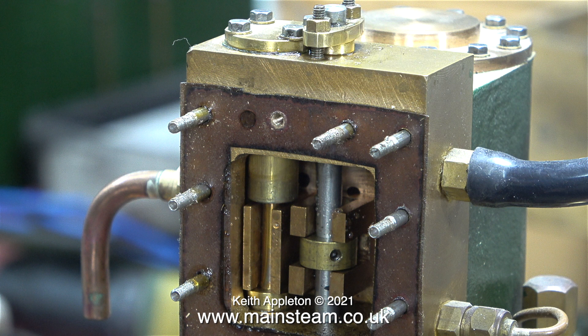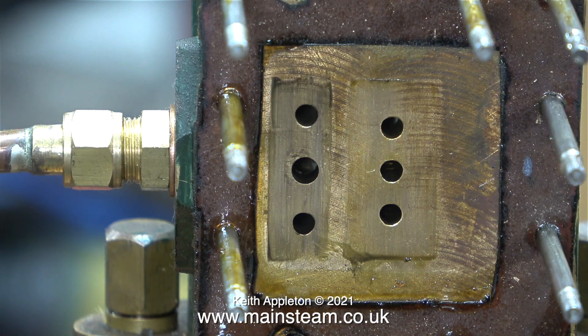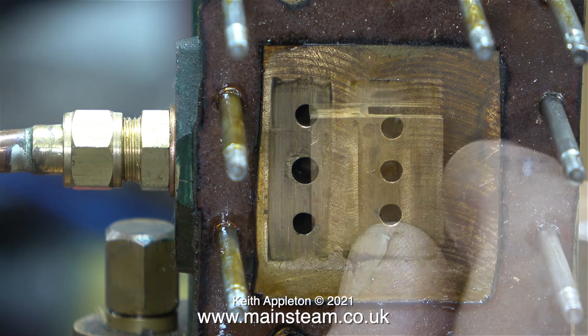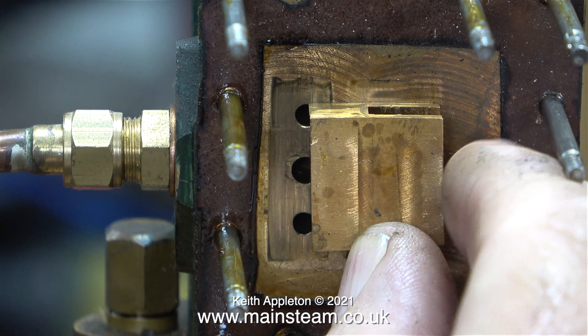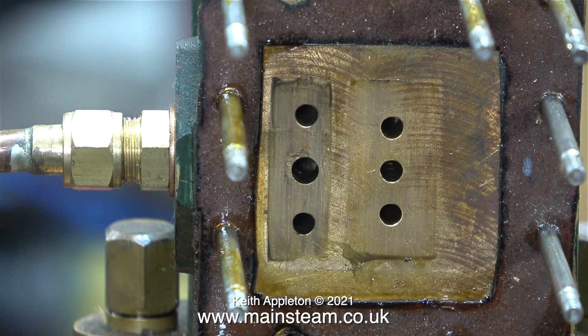Also there seems to be quite a lot of play in the valve itself. To take the pump down further I need to remove the oil feed. Here are the slide valve ports and you can clearly see machining marks, but the pump works very smoothly and perfectly. The shuttle piston valve on the other engine is exactly like this one — look how close it is to the edge of the ports. On the other pump I thought that this was wrong, but no, it was me who was wrong.